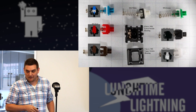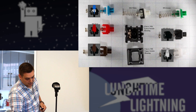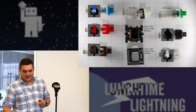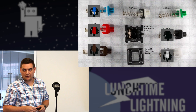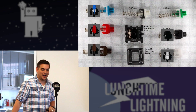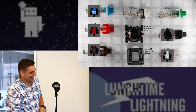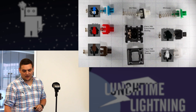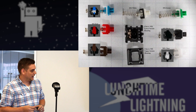The white is a very heavy switch measured at 80 CN — medium stiffness, tactile but with a soft click. The greens are also 80 CN. They're both tactile and clicky — you can feel the tactile bump and hear the click when the activation point is hit. They are very stiff; greens are probably the stiffest switches available. The blacks are 60 CN and were one of the first mechanical keyboard switches available to the public. They are linear or non-tactile — the switch has no loud click or bump when the key is depressed.